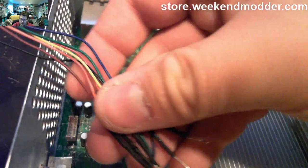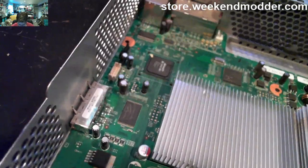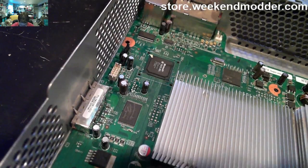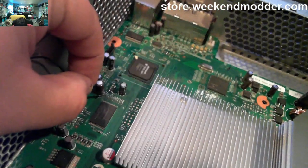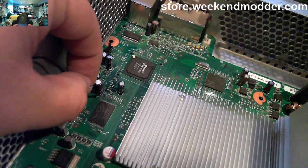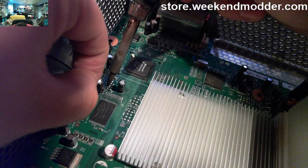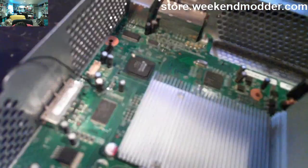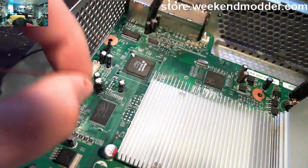This is just a standard default set of NAND wires that I reinforced with some hot glue and then added resistor legs on the end to make them a little bit more durable. Since I've got little solder globs on each pad kind of built up, what I can in essence do is simply hold the line right there, tap the solder, and then kind of shove the end of that resistor leg or the end of the wire into it.